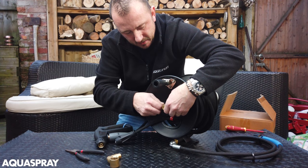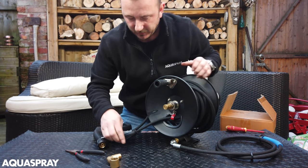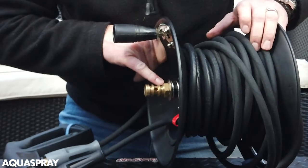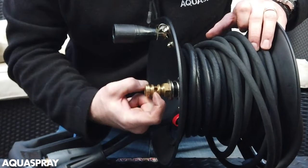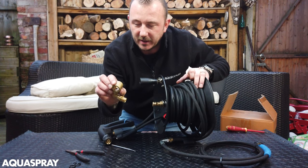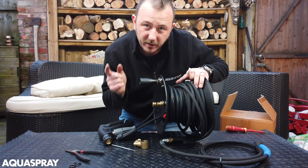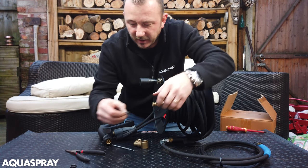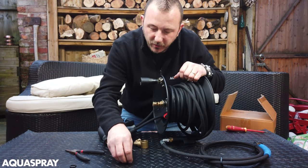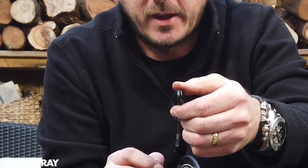Just pick the O-ring and keep going round until you eventually get the whole thing off. Same with the flat washer — if it comes straight you can break it if it's easier. So then you have a recess here and a recess here and the hole. The hole is where the water comes out and you need to seal it inside this. You need the flat washer, and on the flat washer itself there is a groove, and that groove is where the O-ring sits in.